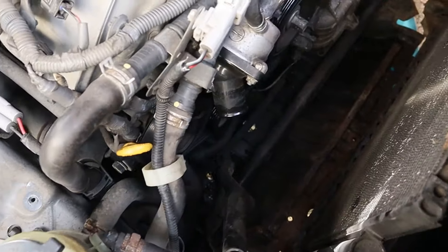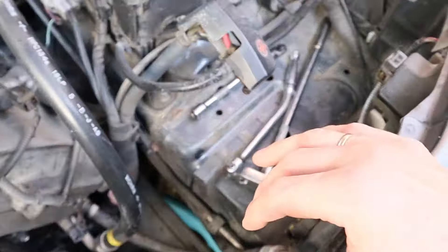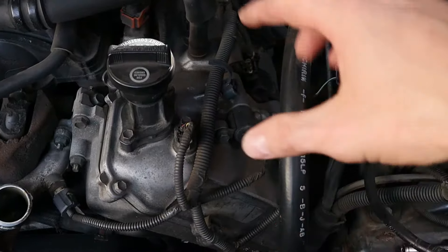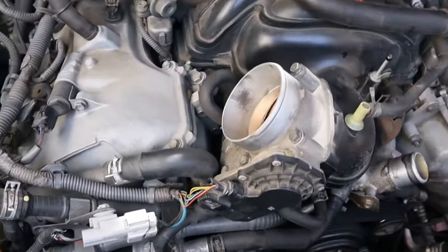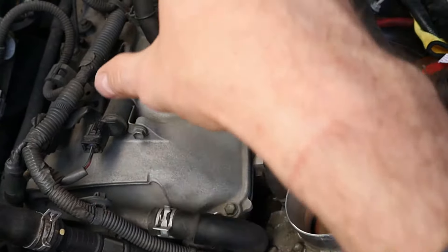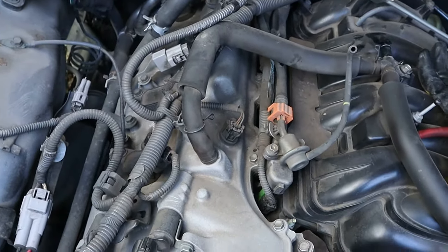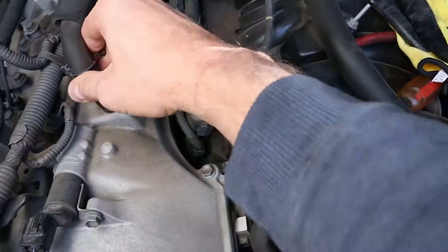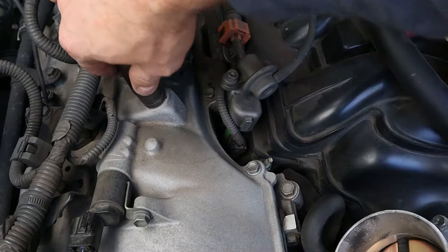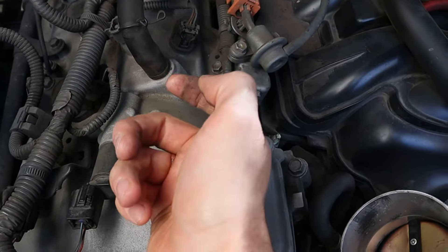I've got some parts out and we have much more access now. I pulled the radiator and we have pretty good access to work on the front cover. I also took the battery out. Next step, I'm going to take the valve covers off. To take the valve covers we need to disconnect all the wire harness and pull all wires away. Also disconnect the coolant lines going to the heater core — those lines will prevent you from pulling the cover up. Disconnect the breather hoses carefully, as they're old and dry and might crack.